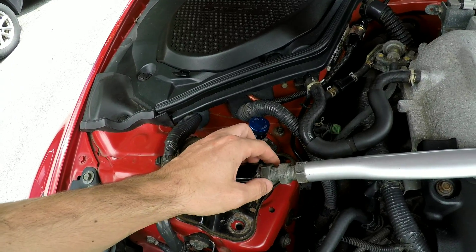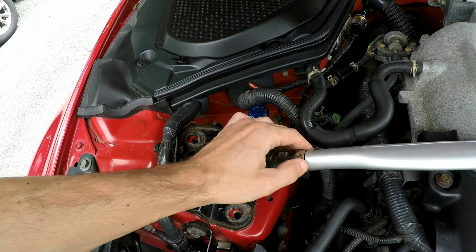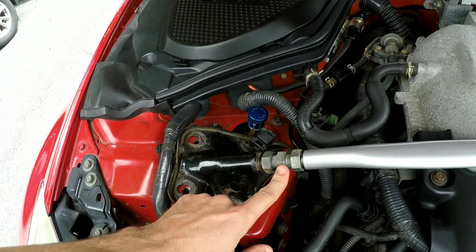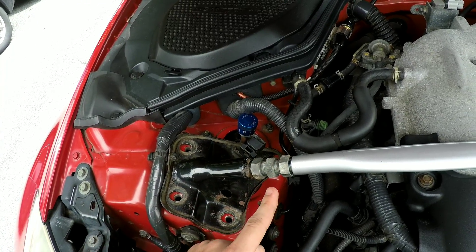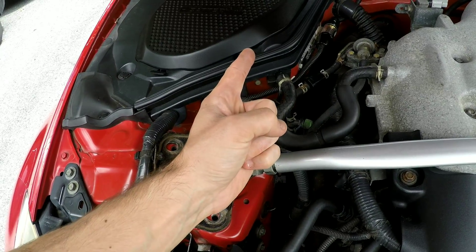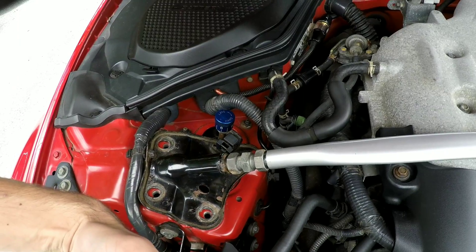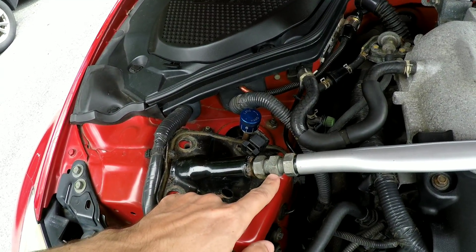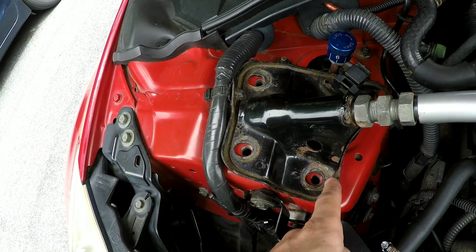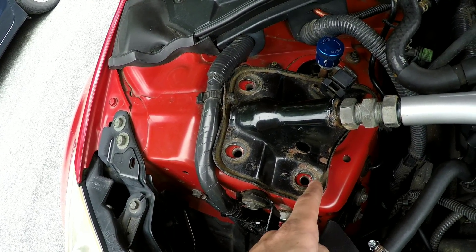In order to adjust the positioning, these are already pretty loose and you're going to get these lock nuts inward. To adjust the positioning you're turning this middle nut right here. In order to make the bar squeeze in you're going to turn it towards the rear of the car; in order to make the bar push out you're going to turn it towards the front of the car.